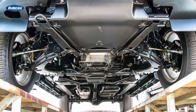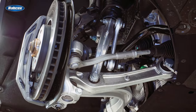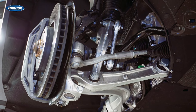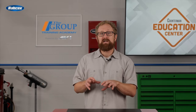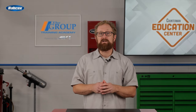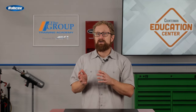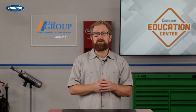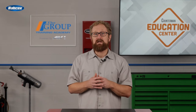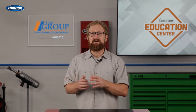But what about under the car? These bolts and studs that stretch are becoming more common there as well. Many of today's tie rods, ball joints, and other suspension components actually use torque-to-yield fasteners. These are becoming more common as OEMs look to reduce unsprung mass in the suspension components. Some ball joints and almost all tie rod ends use a tapered stud and hole with a nut on top to secure the stud to the knuckle. The 7–10 degree angled taper along with a threaded stud and nut lock the components together by tensioning the nut and stud.